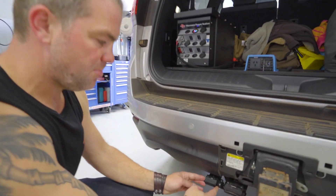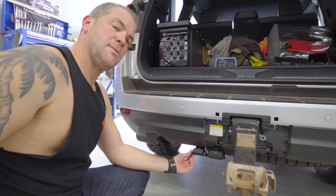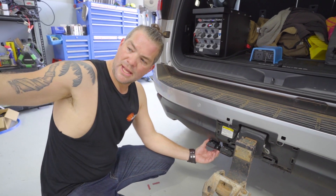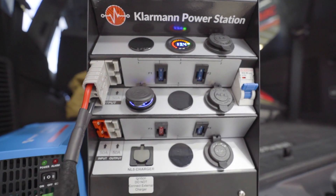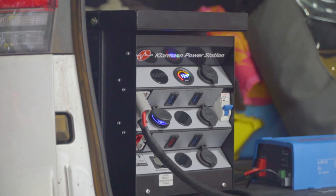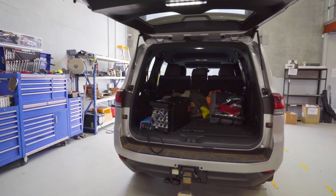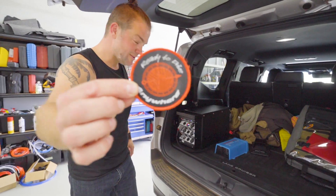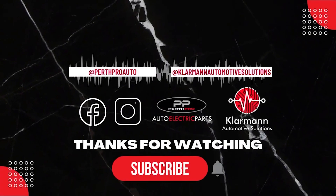The last thing you can see here is where we put the Anderson plug to charge the trailer being towed with this vehicle. When the caravan or camper trailer gets plugged in, as soon as the engine runs the power turns on, delivering power to the trailer and the DC-DC charger kicks in to charge the battery in there. This makes for a very compact and flexible power system — it can be completely removed for everyday use, and when you go camping you put the power station in, you've got your inverter, the caravan is charging, and you've got lights in the back. What a great setup! That only leaves one thing to do — give it our patch of approval. This one is now ready to drive anywhere. Thanks and see you next time!